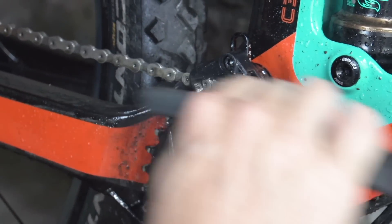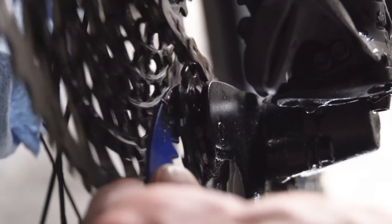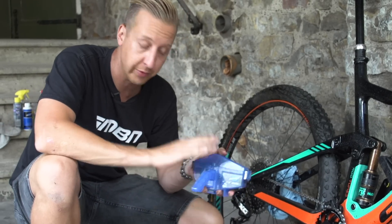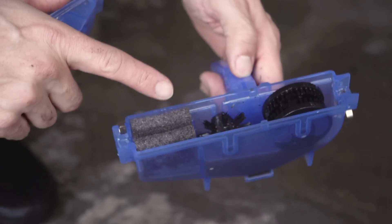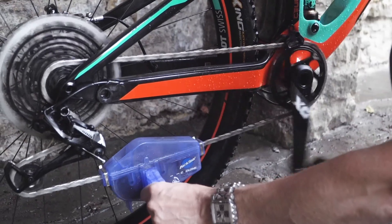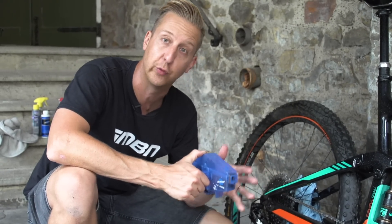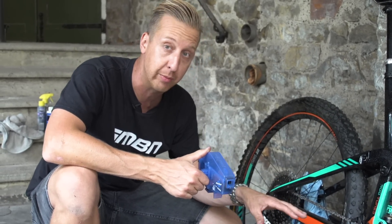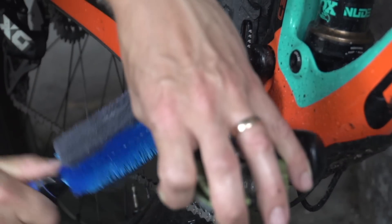The key to cleaning your transmission is a bit of elbow grease. You've got to really get in there and be systematic with your approach — work it around, and sometimes you have to rinse off a bit and then go back to it again. These little chain bath tools are really helpful sometimes — you fill them up with degreaser liquid and there's a series of rollers on the inside that do a really good job as you pass the chain through. But they do use a fair bit of degreaser, so make sure the chain is absolutely filthy before using one. In this case, the spray stuff is perfect for this job with a little bit of elbow grease to get into the actual links and behind the chainring teeth.